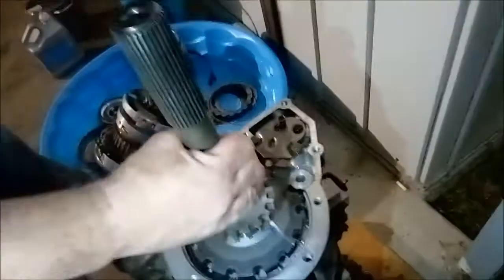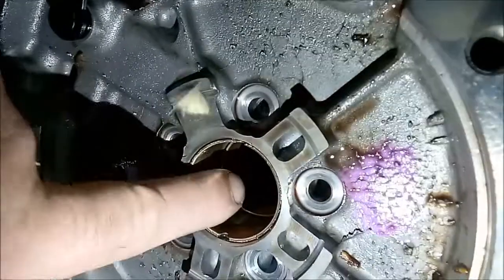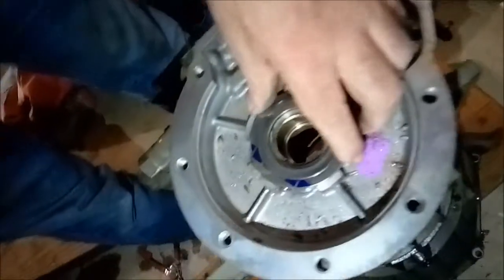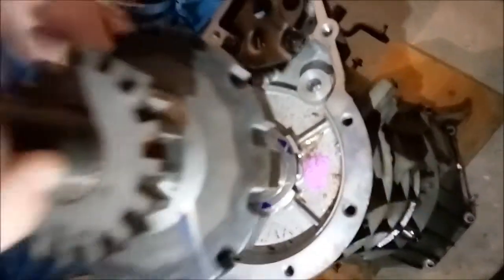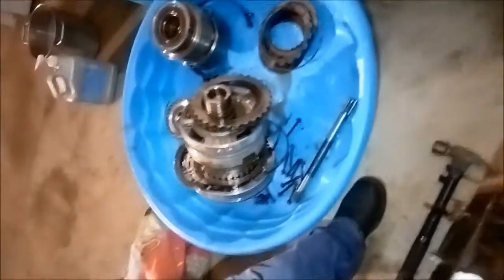The bushings at the very end are called rear case bushings. They now make a one-piece version that fills in the old two-piece bushing set. There is nothing else inside the transmission holding that shaft from shaking — it's just these bushings, plus a seal. My shudder and vibration — both at intermediate speeds and at high speeds — was solely because of those rear case bushings, not from any other internal bushings.